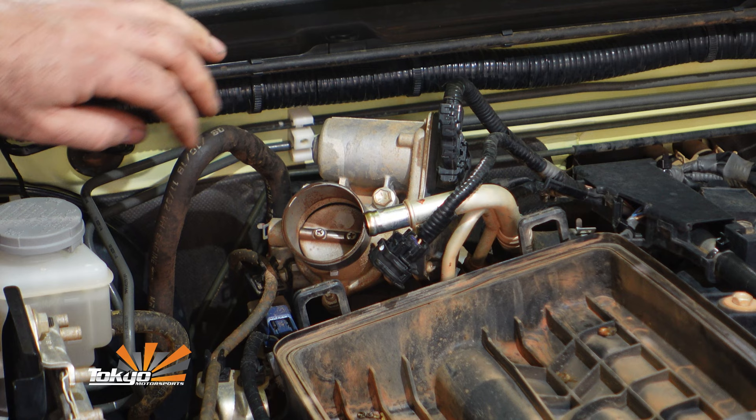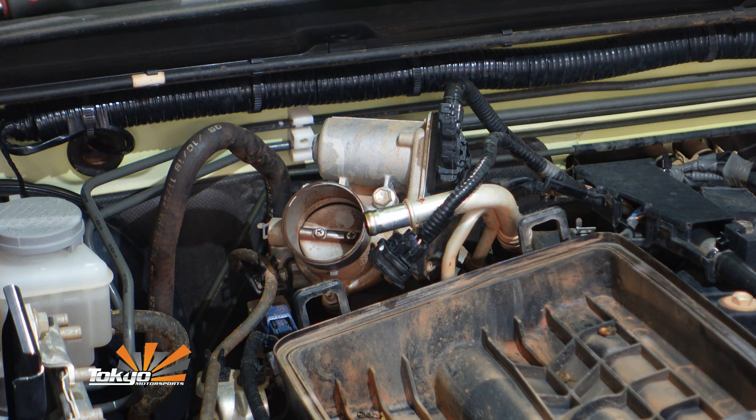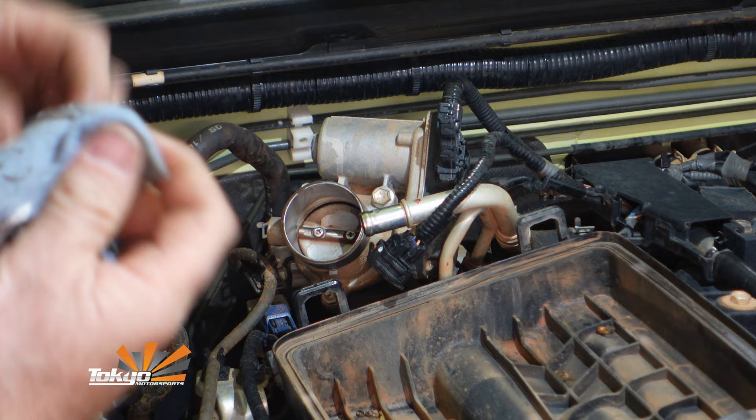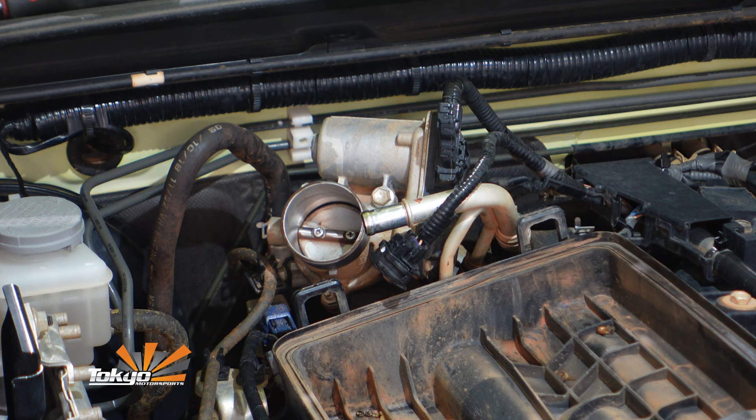I've taken the intake off Tony's car to see the throttle body and it is absolutely filthy — not surprising considering the amount of adventures he's been on. As part of the air filter change, we're going to clean this throttle body out using a little bit of carby clean. Be aware that carby clean will chew paint — it is pretty nasty stuff, so just be careful when using it. I'm going to start by wiping the interior and the butterfly first to make sure we get any debris or dust out before we open the butterfly up and clean the throttle plate and just behind that as well.